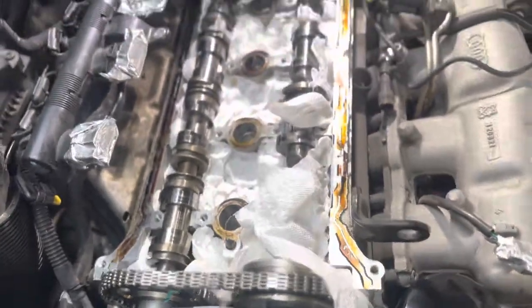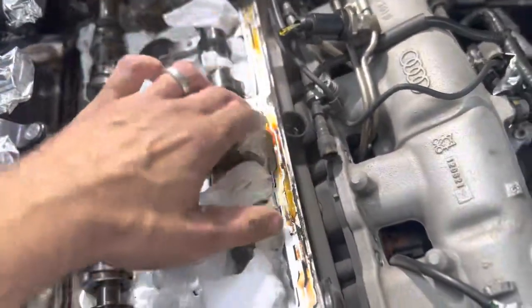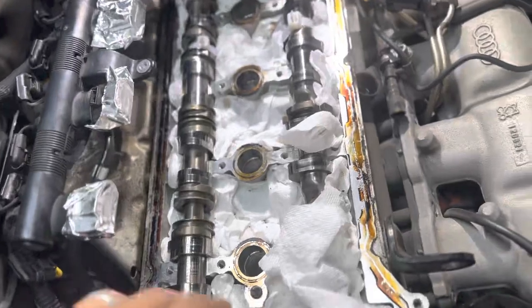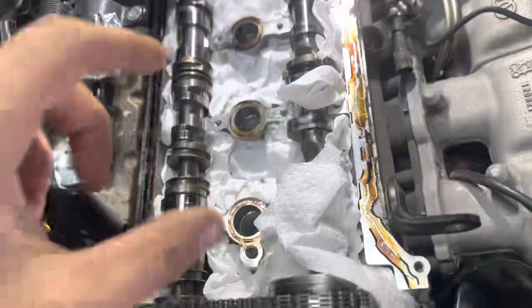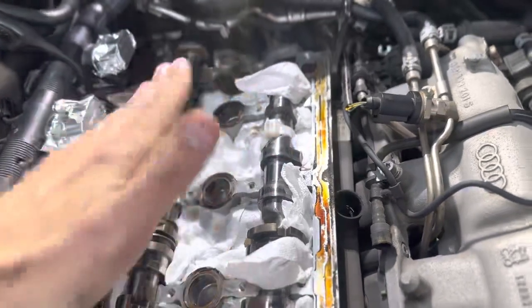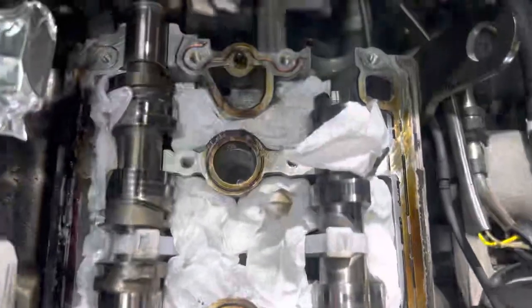What I want to show you guys is what I started doing: instead of vacuuming out all the little pieces from this old gasket material, I take a roll of paper and go one, two, three, four, five — there's like 15 pieces in there. What that allows me to do is prevent gasket material from going inside the engine; you want to limit that. When I take these out very carefully, I just do a little bit of light vacuuming to get everything out, and then carefully reinstall it back. This way it keeps it as clean as possible.